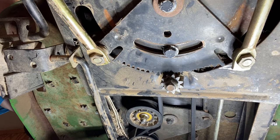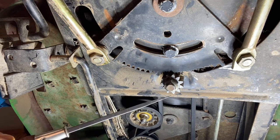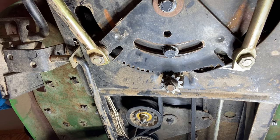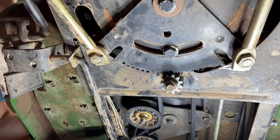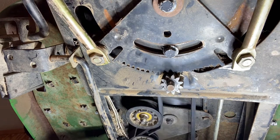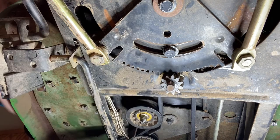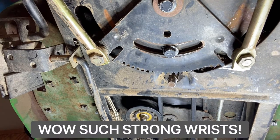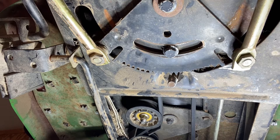In order to remove the sector gear, the first step is to remove the pinion gear. This shaft goes all the way up to the steering wheel and it's got a lock nut on the bottom. My favorite method — if you've been watching my videos, you know I'm a big fan of impact wrenches — just put that on there and it comes right off. A lot of people online are whacking on that steering shaft; I don't like to do that. I just give it a good jerk from the steering wheel up top and you can see it just pops right off. Real simple — then you have the pinion gear removed.